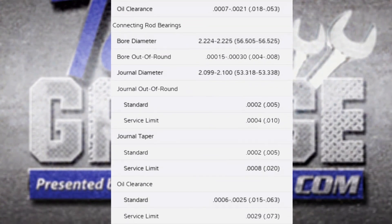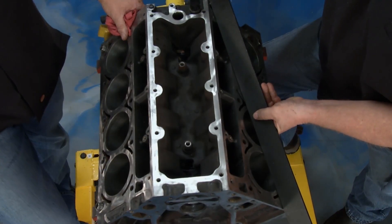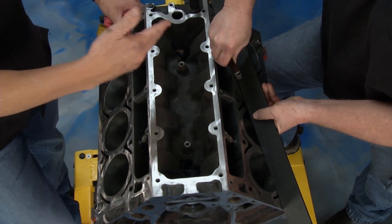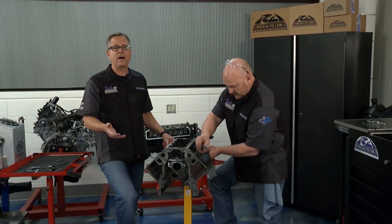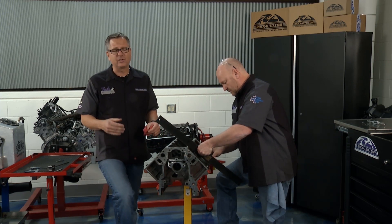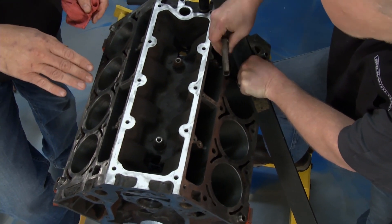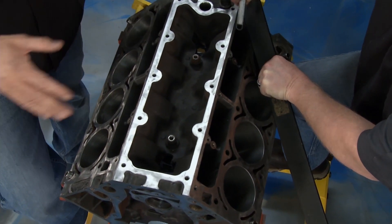What does that mean? We'll do that a lot. Basically, we're setting it up to the max — if it fits through there, you've got a problem. If it goes through there, you're going to have blow-by. That cylinder's not going to seal. You're going to have all kinds of issues with overheating, cooling problems, low compression. Not a good thing. If it doesn't fit, you're good to go. If it fits, time to stop — it's not going to work.